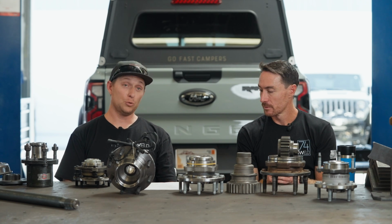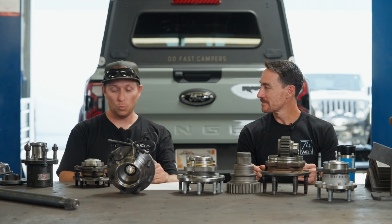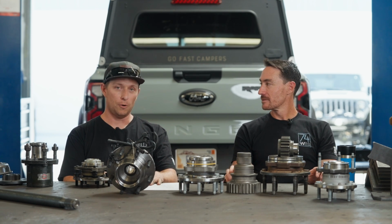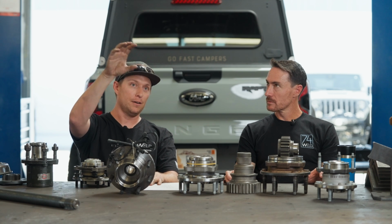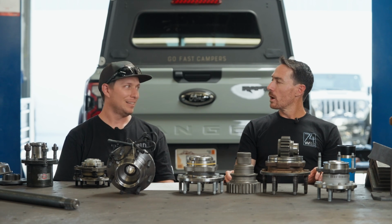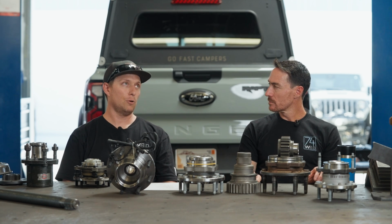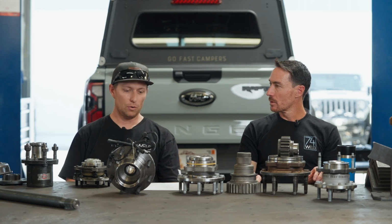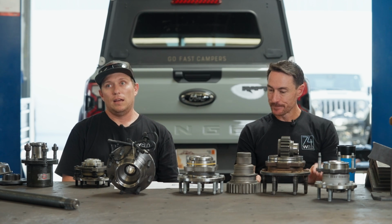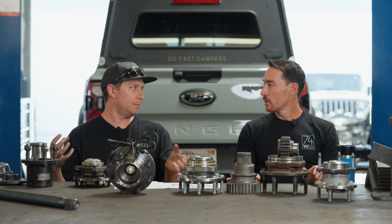And then there's one other 3-bearing design out there. Other than ours, there are other bolt-on portals on the market with a dual bearing pack. So you mean a dual row ball bearing? Yes. There's dual row ball bearing or angular contact. Basically it's the same as just having a bearing on both sides, but one is a preset dual bearing pack.